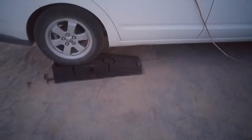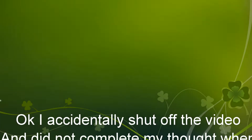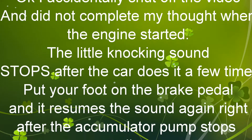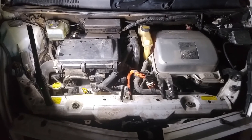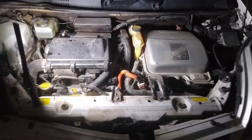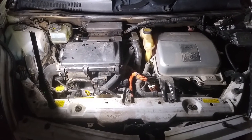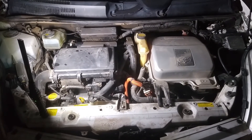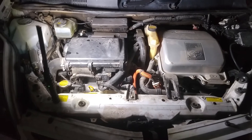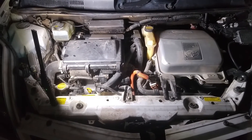So that's kind of weird — you can hear it in the car. It seems like after the car sits for a while. I'm done bleeding the brakes — actually bled them again after the last time. As soon as you tapped the brakes, there was a chirp noise that would happen right as you press the brakes, regardless of how much pressure you put. So I went ahead and bled them again, and now that has stopped. The car is powered on and it's in ready mode in park, and as you can hear, the accumulator pump is not running continuously like it normally does.